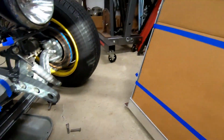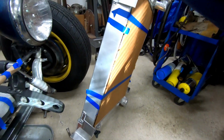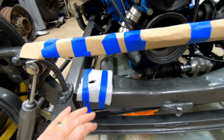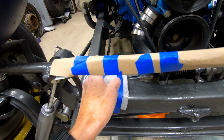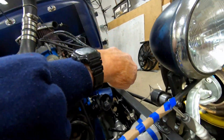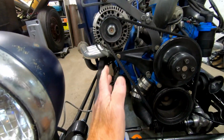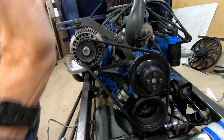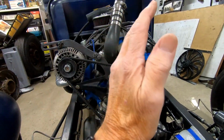So I have a new radiator. It's not an expensive one because I don't want to spend $1,000 and have it crack all to pieces on the rough roads. What I'm going to do, I want to mount a plate across here on pads, create a support to go around the radiator and fasten the radiator to this frame with some nice padding, so the frame hopefully will take up the shock from the road and not transmit as much of that into the radiator. The radiator will be allowed to have some flex.